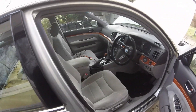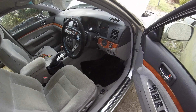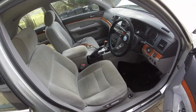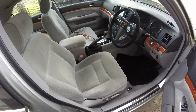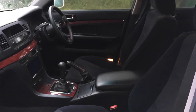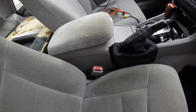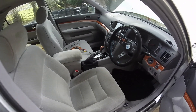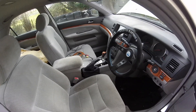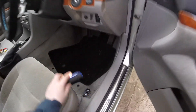Inside the car — this used to have a foot-operated handbrake and that's been removed already. I've just been unbolting it and fitting a standard IS200 handbrake. The standard IS200 handbrake is on the left-hand side of the center console for right-hand-drive cars, and on the right-hand side for left-hand-drive cars. I've got a manual Mark II as well and the handbrake's on that side, so a bit strange. As you can see I've had to butcher the center console to get it to fit — I might have to get an actual center console that fits. But it's just the standard IS200 handbrake with the cable that goes underneath the car and it fits no problem at all.